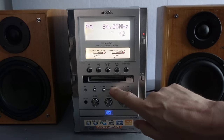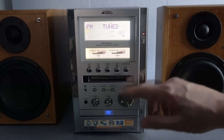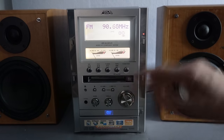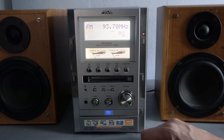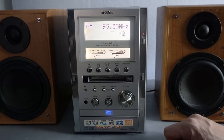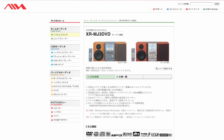If you're wondering why it's a bit dark in here, it's because I've turned off every light in the room hoping that might improve the reception — LED lights often interfere with radio reception. I can pick something up so the radio is working. However, I can pick very little up. It's skimming past the vast majority of stations and going all the way through frequencies and back round to Radio 2 again. Normally I'd pick up quite a few things in the middle here. It's jumping past them because it's considering them not a strong enough signal. I suspect the antenna socket on the back is damaged — another thing that's not right with this at all.